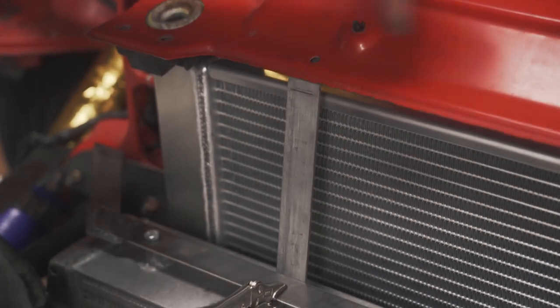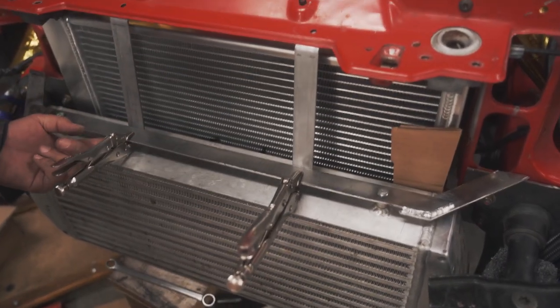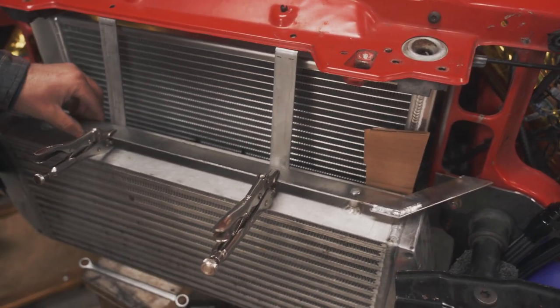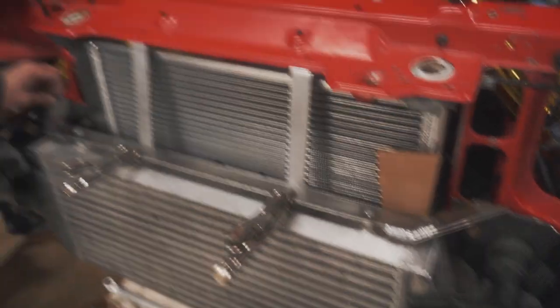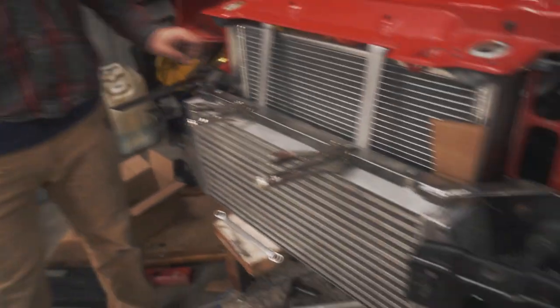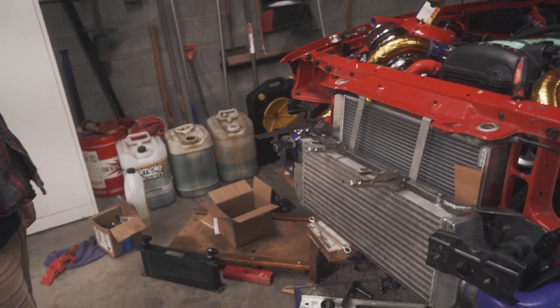That'll be that. Okay. What you gonna do? I'm gonna drill these holes here. Bang, bang. Then this can be welded here, around, and that will be very sturdy. It seems very robust. And this will be welded here. If it was me, I honestly would have just hung it by the air cooler piping. Yes. But this way, it will stay there, no matter what.